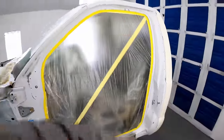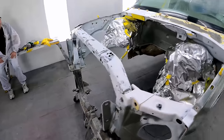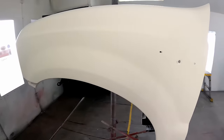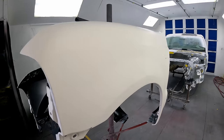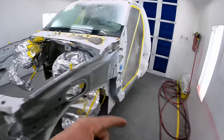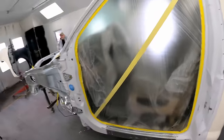But everything is in 320, red scotch pad and stuff. I'm going to go through right now and we're going to do a single coat of unreduced epoxy primer on everything. I'm going to let that sit for about 24 hours and then I'm going to come back tomorrow and we're just going to shoot the single stage straight over it. No sanding because epoxy.